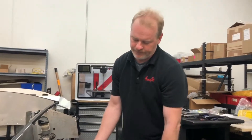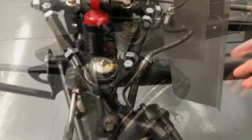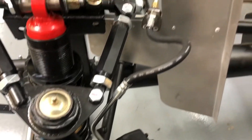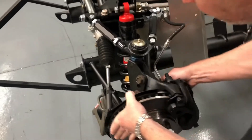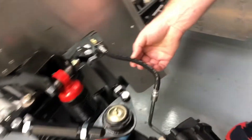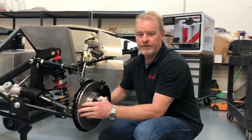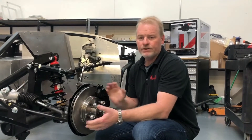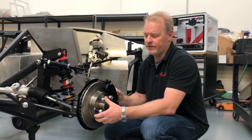Now remember, when we turned the wheel all the way to the left, we were crimping the brake line. Let's try it now. Now that's all the way to the left — we've got a solid stop with a polycarbonate insert in place. Now let's turn the wheel all the way to the right. Now we've still got some flex in the brake line. So we've got the optimum articulation left to right for the configuration of our brake lines, and we don't have to worry about the wheels interfering with the frame or other parts of the body.